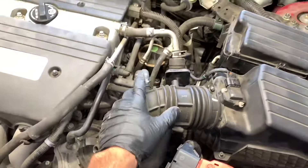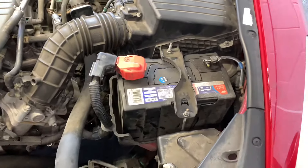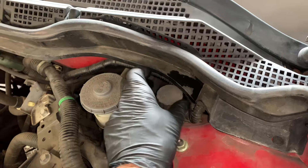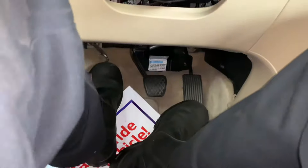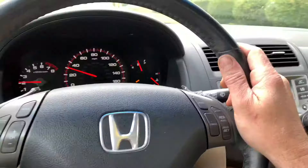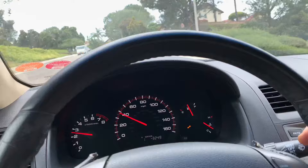Install the battery, hold downs, and cables and tighten everything up. Suck the old fluid out of the clutch reservoir, put in fresh hydraulic fluid, and top it off. Check the clutch pedal — pump it and confirm you have a firm pedal. If not firm, bleed it: use the bleeder screw on the side of the slave cylinder, pump the pedal, and open the bleeder just like bleeding a brake system. The pedal feels good, gear selection is smooth. Go for a test drive to confirm everything is working well. All parts and tools used are linked in the description. I'm Brian Essa from How To Automotive — thanks for watching, and visit howtoautomotive.com for more videos.